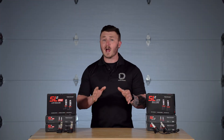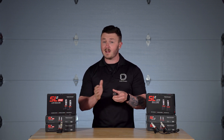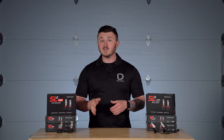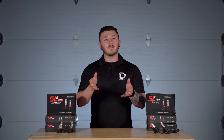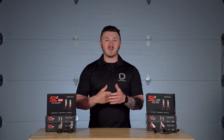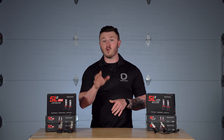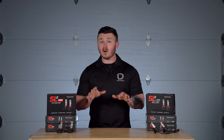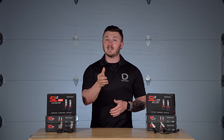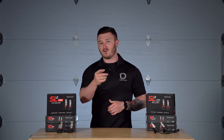To maintain correct optical focus, it's important to note that the LEDs should face to the sides, and the collar should be up and down when installing. To achieve this, you may need to adjust the collar. The process is similar between our SL2 and SL2 Pro, but for our example today, we'll be using our Pros. Before we get started though, it's important to note that these bulbs and all other LED bulbs on the market are not legal to use in headlights in the United States on road. Now, let's adjust the collar and get that perfect fitment.